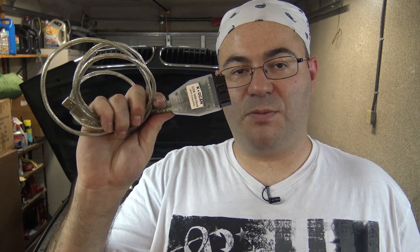They basically cost about $20 to $25. Both of them do come with software. This one is going to be a lot easier to use than the software that comes with this one. This cable can be used with multiple different kinds of software. The software that it comes with is called INPA — I think it's BMW's factory software. There's also something called DIS, which is the Diagnostic Information System. That's what the dealer has. They have a DIS computer terminal in the shop they can plug into cars. They don't use this exact cable — they use a much more expensive one. This is basically a clone of that cable. It's not the best clone. Not everything works when you're using DIS, but it does sort of work. There's also another piece of software called Progman, Program Manager.